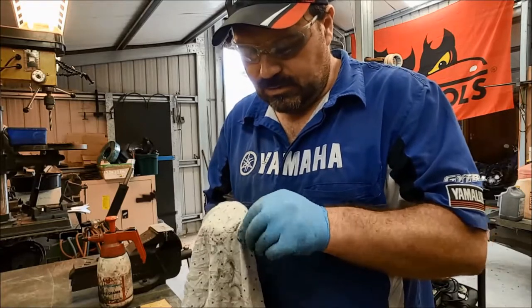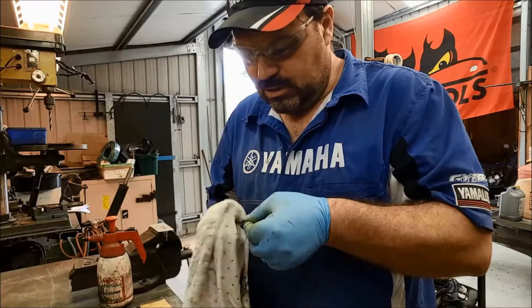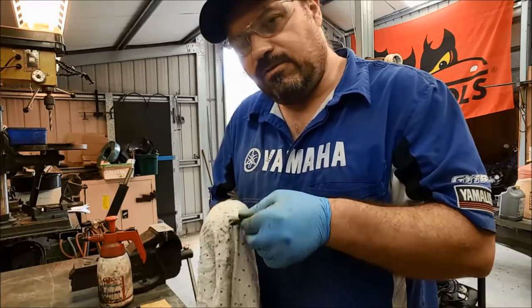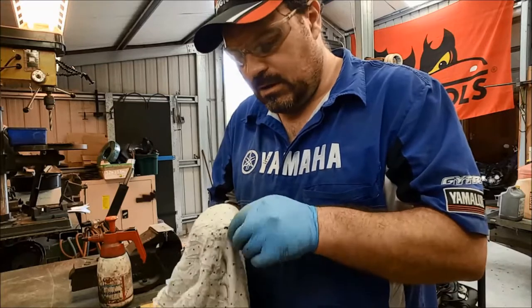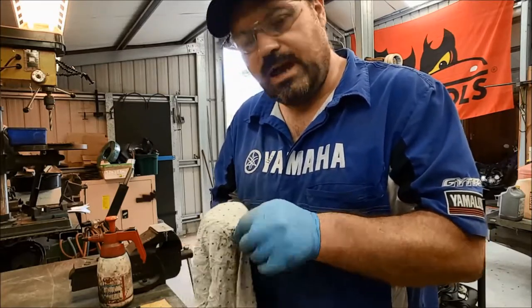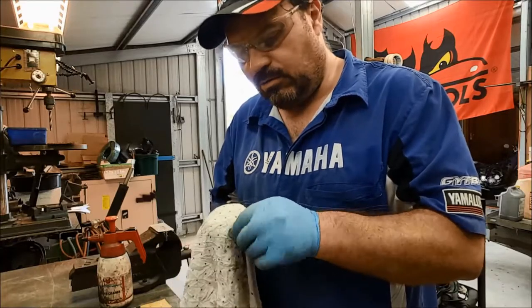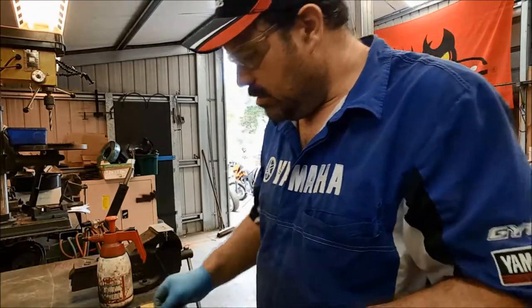I'll just advise the customer, if he isn't going to pay for new ones and it needs new ones, then it'll work fine for a while. He does only ride on the road, he doesn't go off-road with it. I mean, there are some calipers out there that don't have dust seals. They only have the main square section seal. That's it, a lot of Range Rovers and stuff like that. Which is bizarre, I know, but that's the way they are.